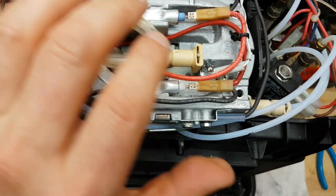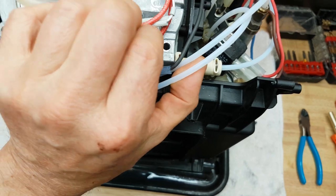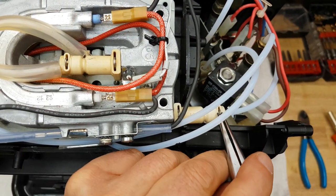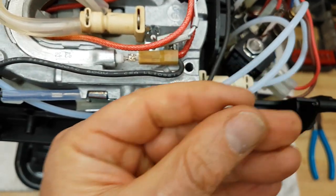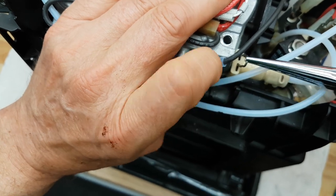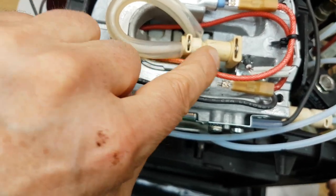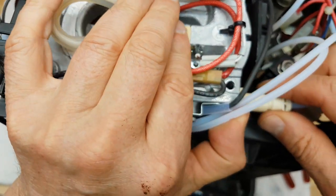This thing's loose and now we'll have to disconnect all these little water lines here, these high pressure lines. You can just remove the clips — I use a pair of needle nose pliers, you can also use a pair of wire clippers, that sometimes works better. These little clips are very common, most of them look very similar or the same in different machines. These two here I'm not going to replace today because I've done that in the past, so we're just going to leave those.